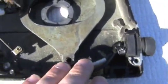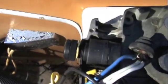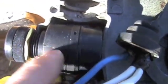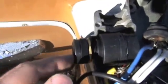I've gotten all the wires soldered back in on these, and I've got most of the wires hooked into this ignition. Here's the difference between the ignitions: this is the old one — it's got these little prongs in the back — and that's what it looked like in the front. You can see that whoever had it just destroyed it, so there was no hope for this one. This new one comes with plugs already wired out of it, which I like. It also has an electric choke where you push the key in and it'll choke it, but I'm going to make it so the choke on top still works too.